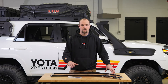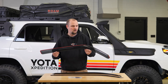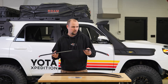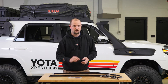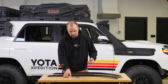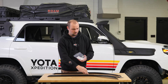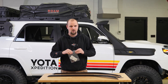After a brief look at the instructions for installing all of these, we actually realized that the in-channel design really isn't going to work on the 4Runner. We're not super happy with the way this fits. The channel on the 4Runner specifically isn't very deep and is basically just wide enough for the window to fit in. On older vehicles this would probably work fine, but on the 4Runner the window channel is almost exactly the width of the glass, so there's no extra room to wedge this in. Additionally, the instructions tell you to use the included scotch-bright pad to scuff the rubber surface inside the window channel so the tape adheres — that just didn't feel right to us, and after investigating we definitely won't be installing the in-channel visors on our 4Runner.